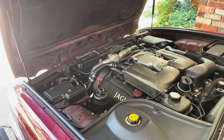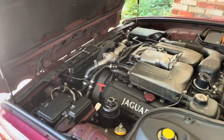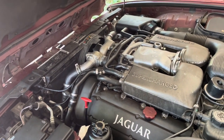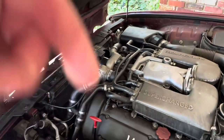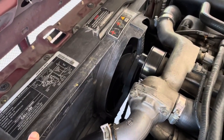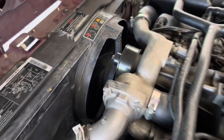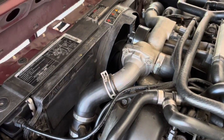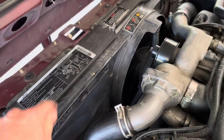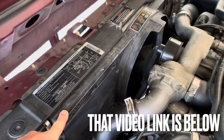Hello mates, Mitch Brooms back. I can say that I really effed up really bad on doing this car. I'll put the video in the description below on how to replace this fan, the whole assembly. I had the top fan going out — I sorted it out. I noticed the car was running a little hot, so I tested the fans. The top one was burnt out, bottom was fine. I've done this a couple times, four times already.